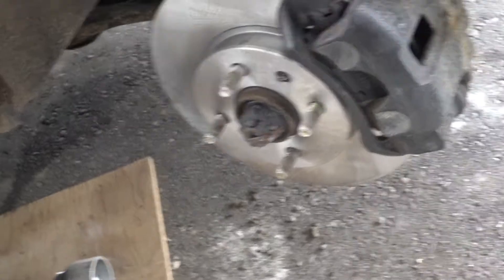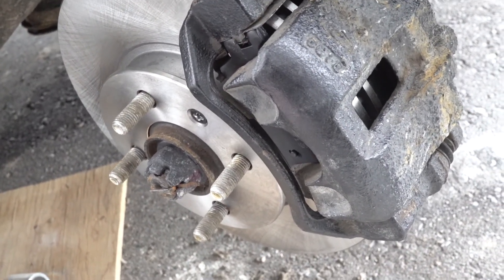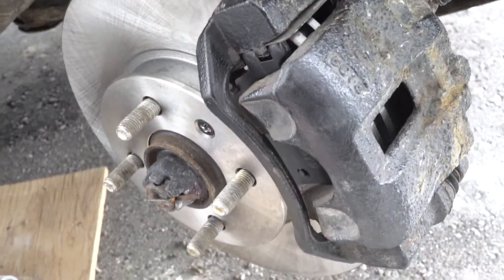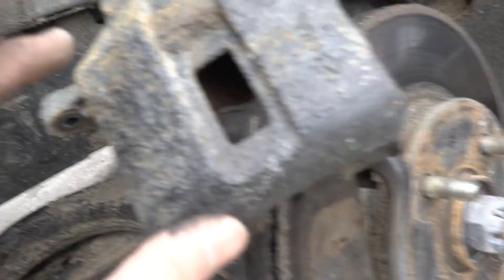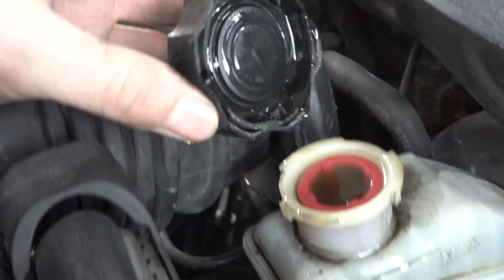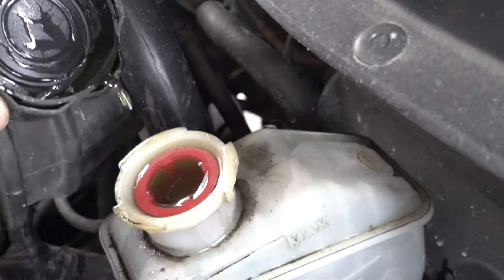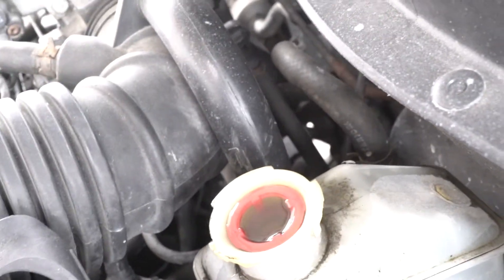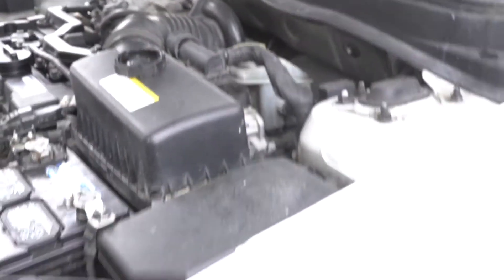We got one side on. The back pad seems a little bit tight sliding in, so I cleaned it off and put some grease on it — it's still super tight, so hopefully it doesn't stick and cause problems. She's looking clean now. I've noticed when I squeeze the caliper closed all the brake fluid leaks out — basically all coming from here, which is now overflowing. I'll try to save some of that out, pump the brakes and try to get her to the right level after.